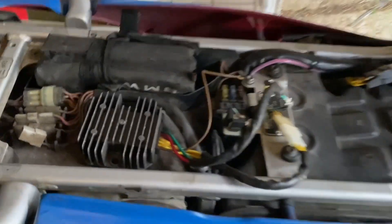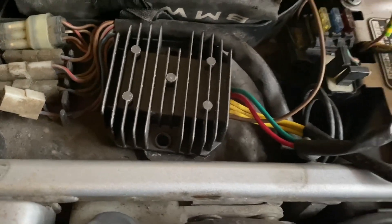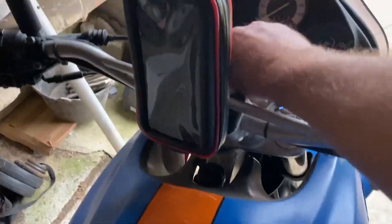Okay, so here we are again. I've changed the voltage regulator — I know it did have a bit of a burnt-out connection on there. I'm going to redo these connections. I've cleaned it up a little bit; it was just getting hot, so I'm going to extend all these cables and relocate it because it's in a really bad position — it just gets so hot there. I'm going to start it again with no lights on this time.